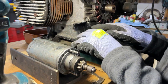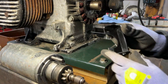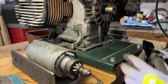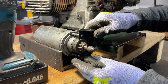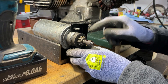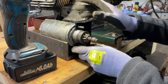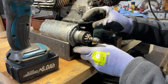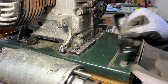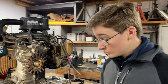If I put this in here you can see that the top part is completely complementary to the angles on the casting, and we've opened up this C-section as much as we possibly can. It's a tiny bit bigger than that, but comparing it by lining these up you can see it's a very snug fit, so the starter motor can only go through this bracket straight — we shouldn't have any issues with the starter motor trying to go walkabout. And you can see we have our bolt hole for the engine mounting bolt, which will work as a locator and keep it in position.